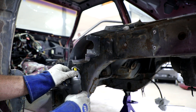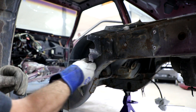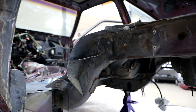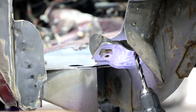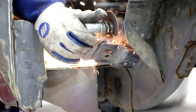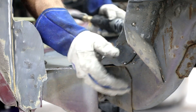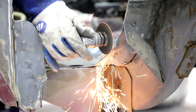Use an air saw to cut around the remaining upper spring perch locator so that just a gusset is left tying the trunk floor to the frame rail. This is also the fold-down seat hinge mount for a hatchback vehicle. Drill out the spot welds holding the seat belt anchor to the trunk floor. Cut the remaining trunk floor that sits on top of the seat belt anchor with a cut off wheel.